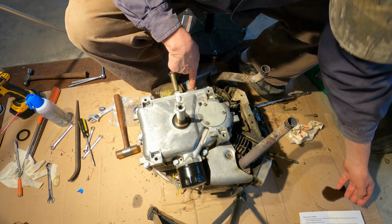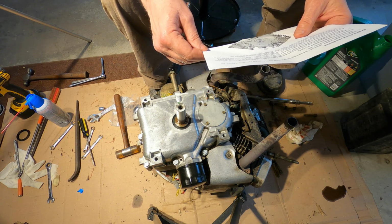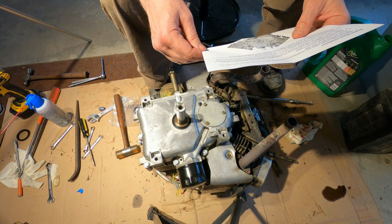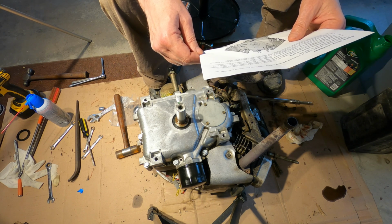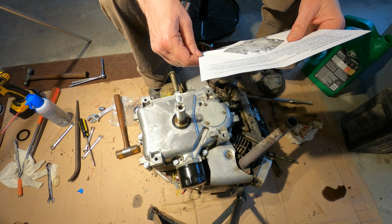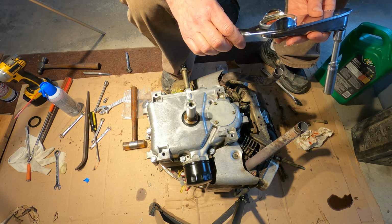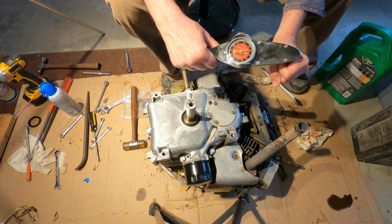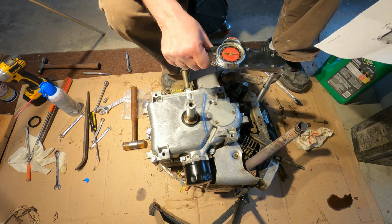I still have to torque these down. And tighten them to 1/3, then 2/3, then to the final torque in the sequence shown below. Final torque value is 325 pound-inches. So I need to go like 100, 200, 325. Okay, this is an inch-pound torque wrench that goes 0 to 150, so I set the needle to 100, and as I torque, it'll get closer to 0. So when I hit 0, I know I'm at 100. It's just how I like to do it. It makes it simple. I'm just looking to hit 0.